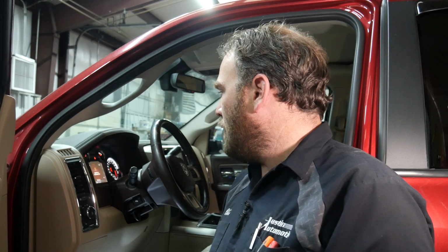Okay, so that seemed pretty quick. Let me go ahead and plug in the Modus. I still have the key on, haven't done anything. Yeah, we got the annoying ding. So I'm gonna plug that in. We'll see how long that takes to power up, because it should auto ID on power up if the key is on. And then we'll go through and do the full code scan and we'll compare them side by side.